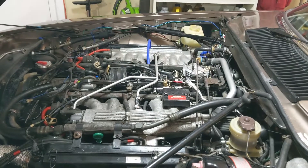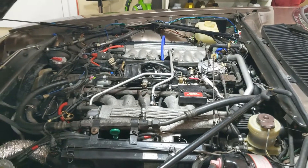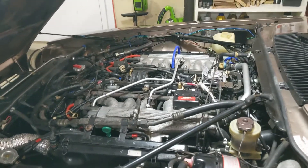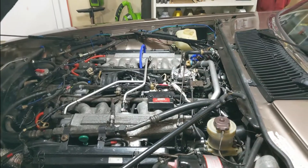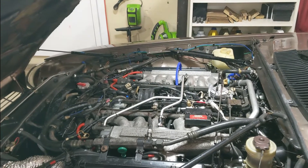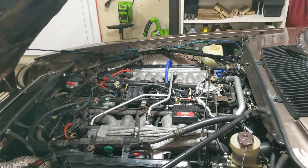Doing another little job/project on my '86 V12. The usual supply of information from the Facebook group and the usual cast of characters that seem to know a great deal about these cars and help us all out. Mine's got a cold start problem. Once it's started it runs fine — you can run it for 20 seconds, turn it off, and it starts fine — but the first start is terrible.